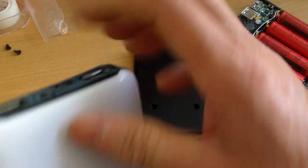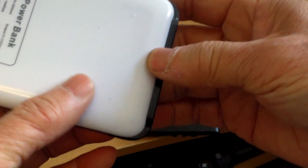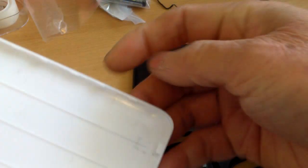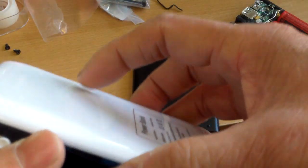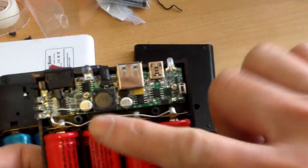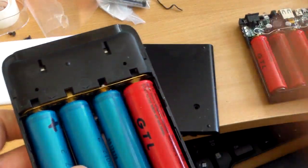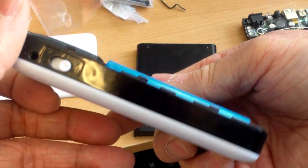So how do you open this? I was trying to pry it open with my fingernails, but it works pretty much like a cell phone — you slide the back cover off about a quarter inch and then lift up. This is important because the little tabs here are very fragile and you can easily break the cover. Without any screws, you would have to use tape to secure it again. This one has a very clean inside; the circuit board is covered, unlike the other one. The batteries are charged in parallel.